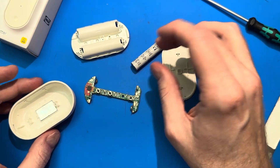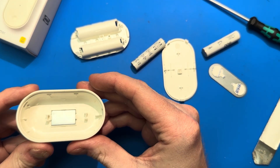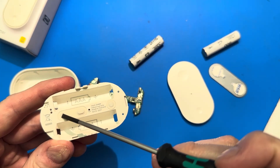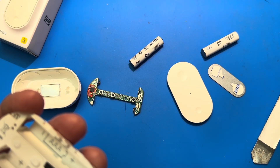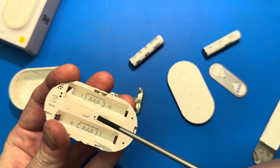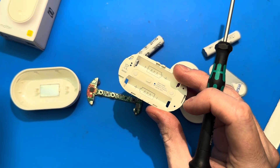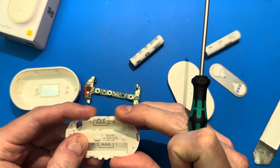The whole thing goes together really nicely with no screws other than that one screw to hold the PCB in. The thing feels solid — it's nice plastic material, just ABS. It's not glass fiber reinforced or anything like that, but it feels good. There's also a rubber piece stuck over the top there, so that lets you press the buttons through the case and gives it a little bit of a weatherproofing seal. It's not exactly weatherproof, and I'm not sure if it's IP rated for outdoors, but it does provide a little bit of protection for the microswitches.